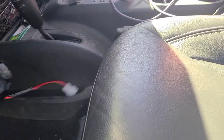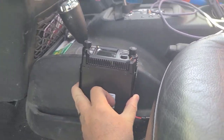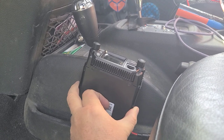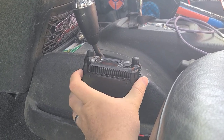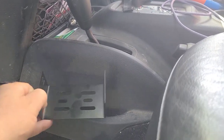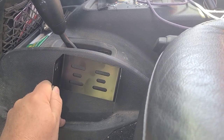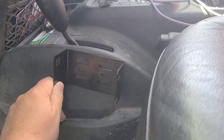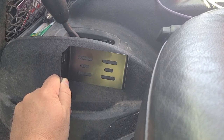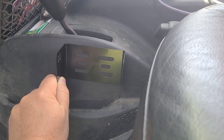We're in the front seat of the Jeep. We decided right down here on the side of the console this fits — it's out of the way, doesn't affect his driving, doesn't hit his leg. But it's still far enough forward that we can move the seat forward for his wife to drive since she's a little shorter. The bracket on this has multiple mounting positions, so we're going to center things up and use the center set of holes. That way if we need to move up or down, we can without having to drill a new set of holes.